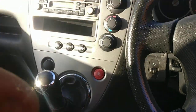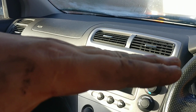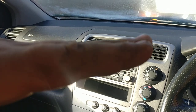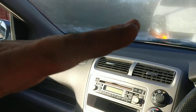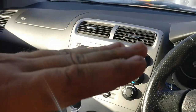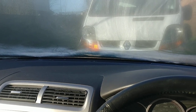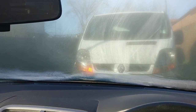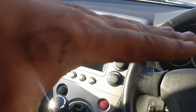Why is this important? If you put it on three, the beam is going to go down. But when you put a lot of weight in the car — say you have your girlfriend and a couple of people in the back — they push the car down. If the beam is set to zero and the rear is pushed down, the beam is going to light up the trees. You'll see birds and maybe people in the trees.